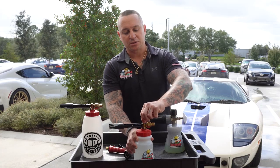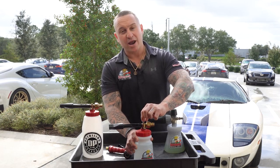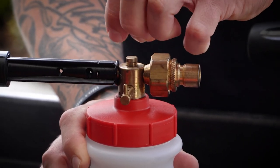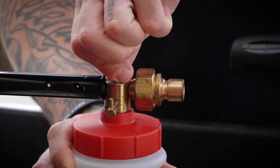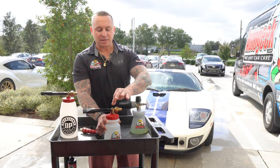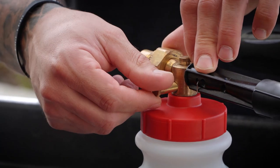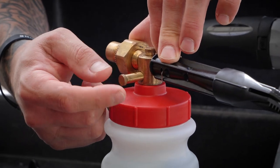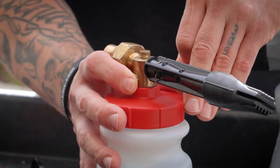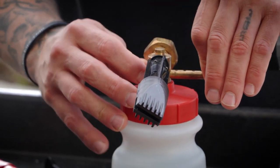On top of the foam gun you'll notice a screw-like piece that allows air in — you're really going to want to ratchet that down and make sure it's nice and tight. Don't let that get loose; keep it tight during use. There's also one on the side that tends to get loose, and that stops the rod from sliding all the way out. Make sure that one is on and secure before every use.